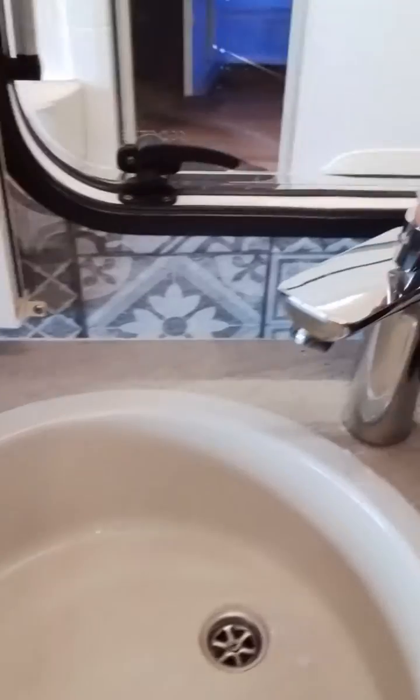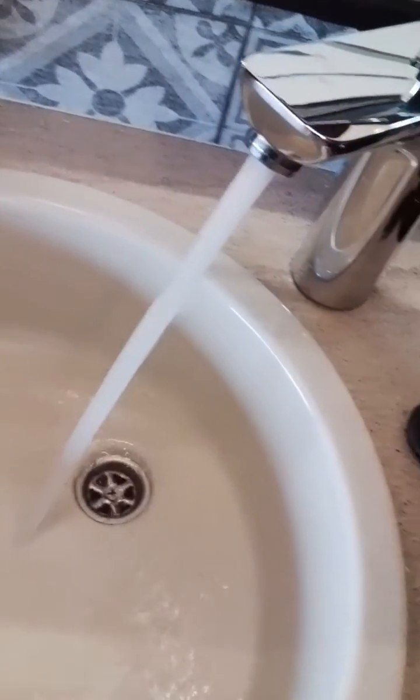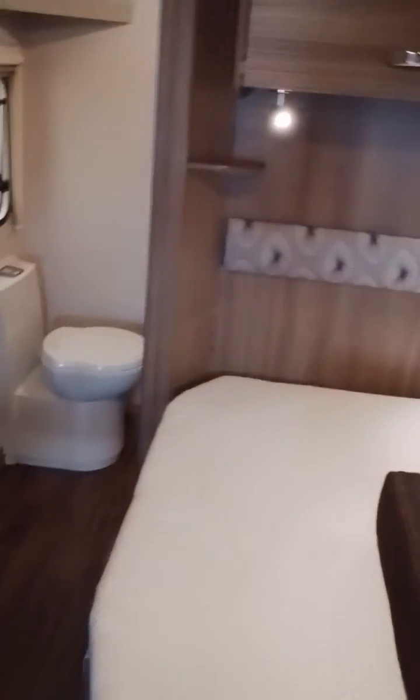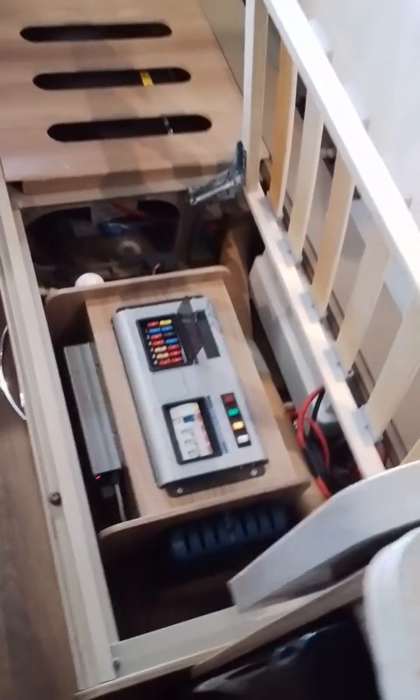Also down here we have your drain off valve which needs to be facing down in the horizontal position until you're ready to drain. Once down you can press your water pump button like so. Then obviously open the taps, pump will start going. And you want to get all the air out of the water system until all 3 taps, so your kitchen, shower and the bathroom tap are all done as well, so all the air out of the system. Then your pump will be calibrated and will turn on and off when using the tap.